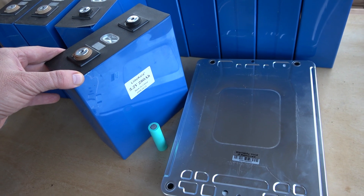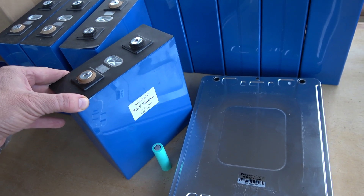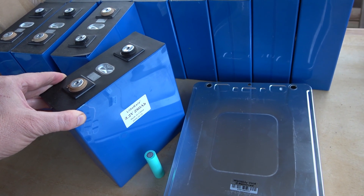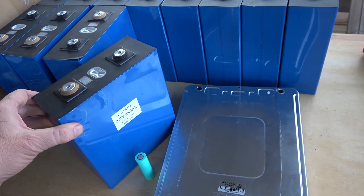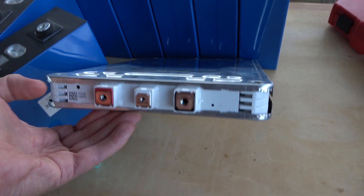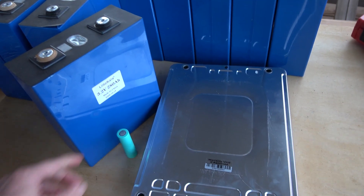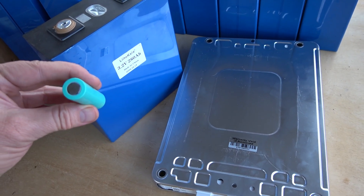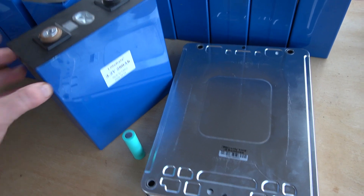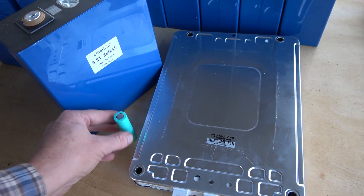If you look at the Chevrolet Volt, you have a 111 kilowatt motor and essentially a 16 kilowatt hour battery powering it at full capacity until the battery is dead — so you're looking at a significantly higher C rate, a little over 6C discharge. That's because even though the Volt also uses pouch cells like the Bolt EV, they're much more similar to the very thin pouch cells in the Nissan Leaf. The reason they have higher power density is because they have a thinner electrode — there's less distance for electrons to travel — and that allows for higher power both in and out.